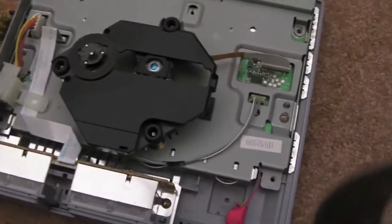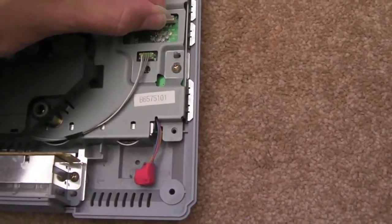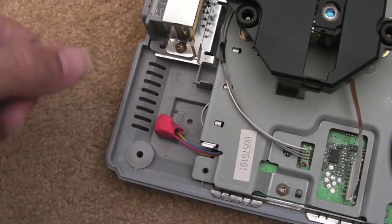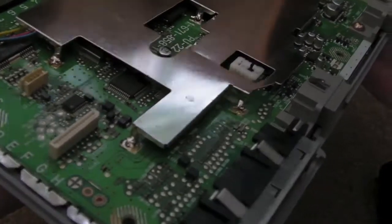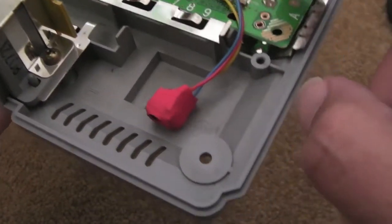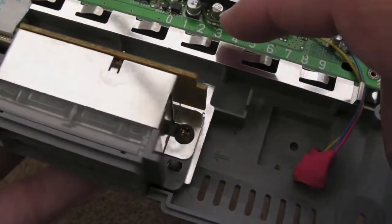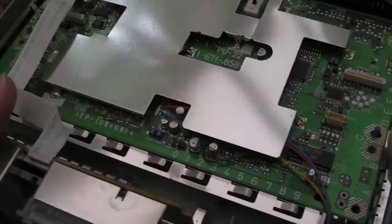So I guess we have to take the CD unit off now. I'll disconnect these two connectors — I think it just pulls out. I'll pull the CD unit off, get the shielding out of the way and have a look at the board. Someone's obviously been at this before and routed the wires for the mod chip here. Seems to be a three-wire mod — there's a green wire on the board and I'm not sure where that's going. First thing I've noticed as usual is SMD caps. At some point those probably need swapping out, but at the moment it's behaving itself — the picture looks really clean and it's loading games without an issue.